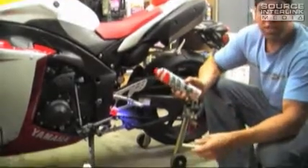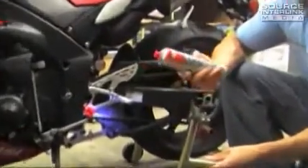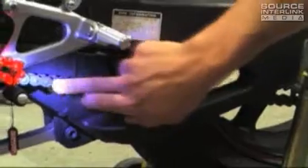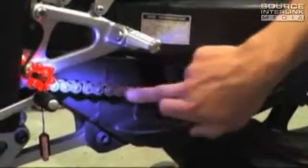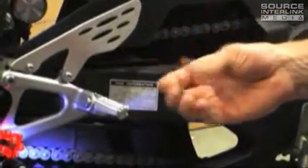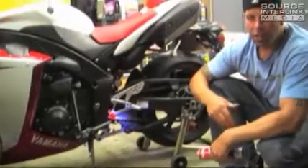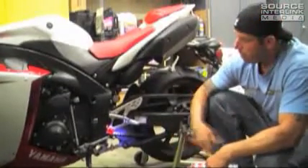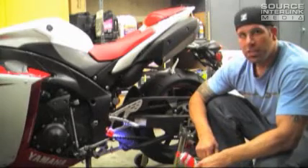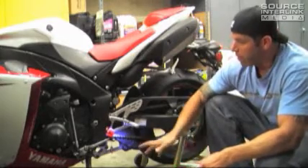What do you use? You use a chain cleaner. When you have grime and filth on your chain, just rolling your finger over it you can see the dirt built up on it — it's not grease, it's just road grime. You clean your face shield on your helmet every time you ride, and you can clean your chain. Not every time you ride, but just common sense will tell you how often you're cleaning it just by looking at it.